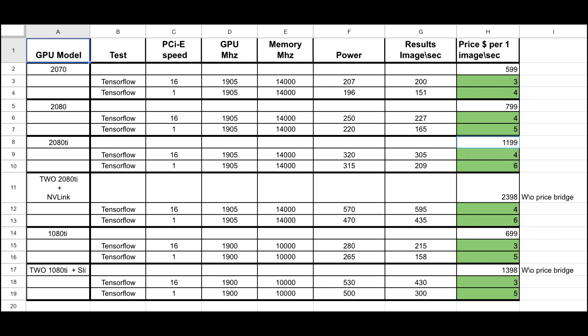While testing out the full line of cards, we obtained results which can be seen in the table. As we can see, when a single 2080 Ti is directly connected to the motherboard at PCIe X16 bandwidth configuration, the 305 images per second reading is obtained, but through a PCIe riser we can get 209. It's better than the result from the 1080 Ti with 215 and 158 images per second, which is 29.5% and 24.4% lower. But when taking account of the price — which is $699 for the 1080 Ti and $1,199 for the 2080 Ti — the 1080 Ti is much more efficient, given that it's 42% cheaper.